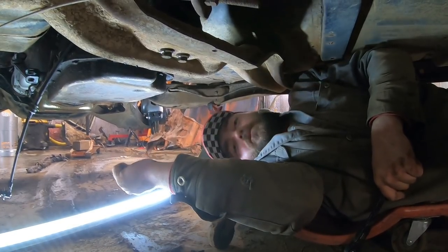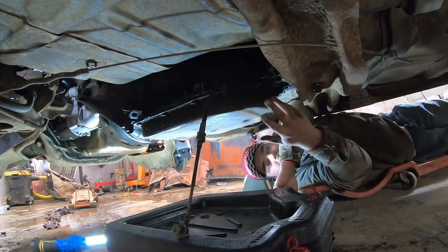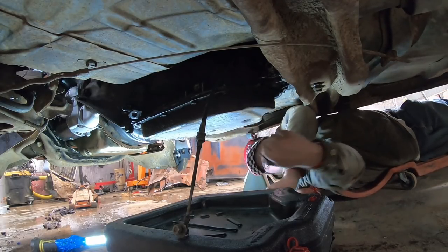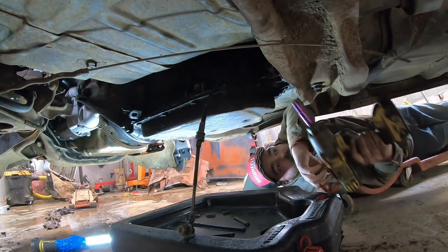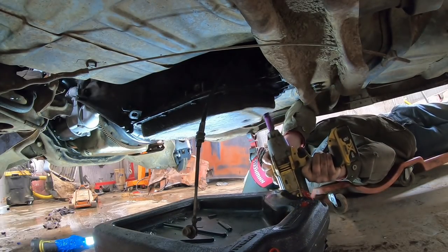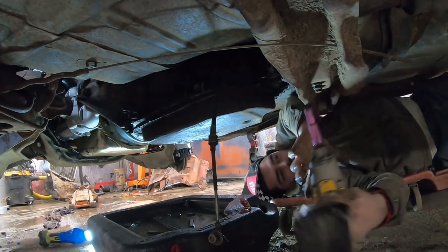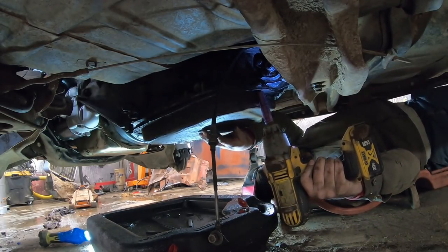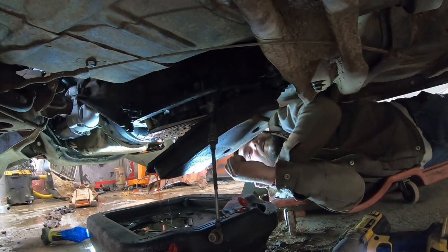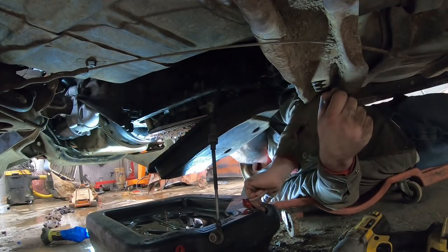When you're dropping your pan, basically you want to pull out all but the last bolt, then flop it down and let it drain. Factory ones don't have a drain plug, so get a pan to catch it — or at least say you tried. I'm assuming there's not even anything in it. Not too much in there. Now we can back off this back one. Hey, that's actually really red — I haven't put any fluid in this. That's a good sign. It looks really clean. We'll have to look at the bottom of the pan — that will tell the tale. You can smell burnt fluid. It doesn't smell burnt, but there's a lot of stuff in the bottom of this pan.